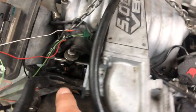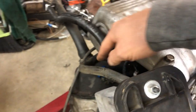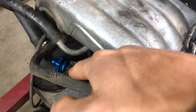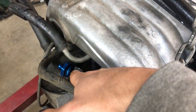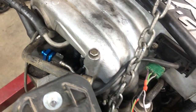As far as the injection system, I am running the returnless rails, so they do not have a return line at all — just a single feed. This is a Russell 6AN to Ford fuel pressure side fitting adapter. I have one just like that on the truck running to a braided line. If you're using the stock line, just be aware that these fittings have a very small inside diameter compared to the aftermarket, so you'll probably want to get a new one.